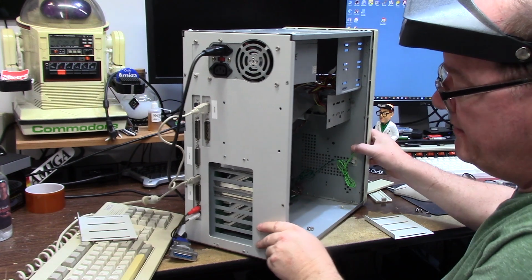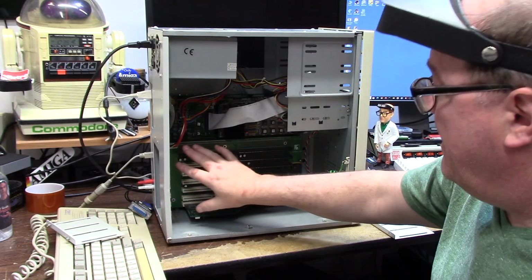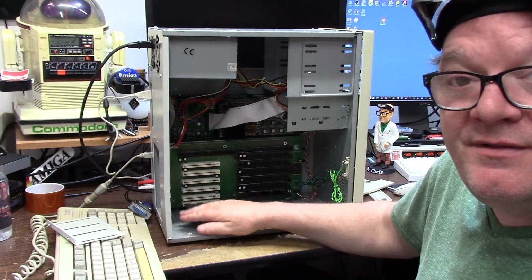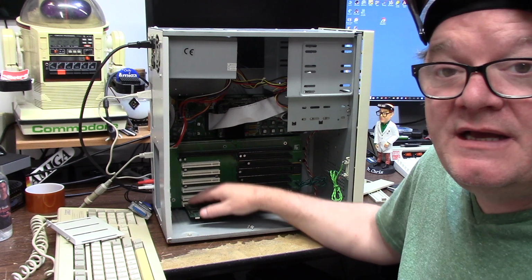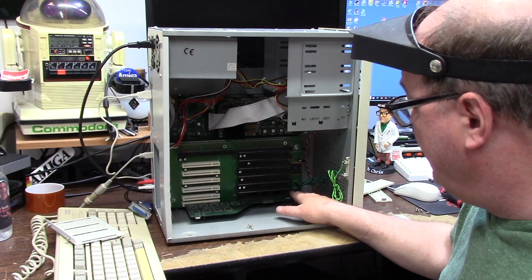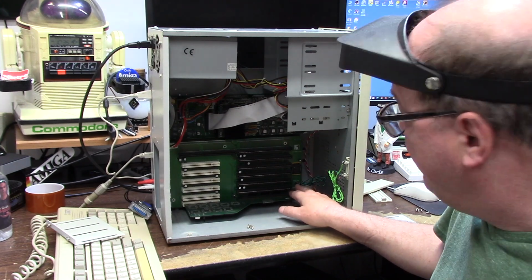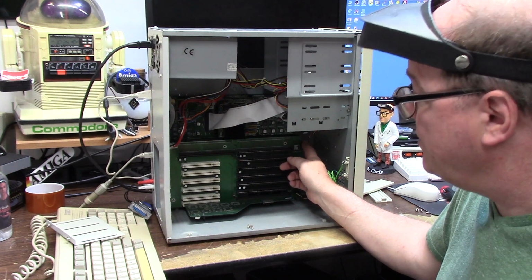That's epic. So, I mounted the 3640. I put in the Elbox riser card. This is an arbitration bus board that allows the PCI to talk together. Gives you 5 PCI, 6 Zorro 3. The power LED and reset switch plug into the mediator board itself. The single wire hard drive light plugs into the standard Commodore spot.